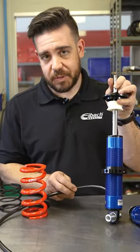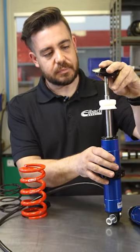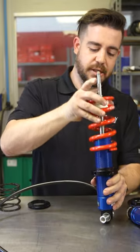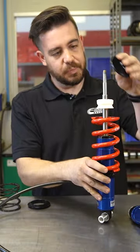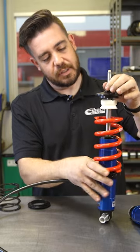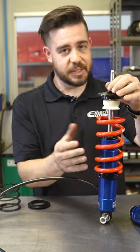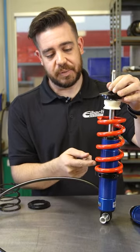As an example, we have this fixed body coilover right here. If you were to take this mainspring and drop it on, then put the top on, you basically have a whole bunch of slop in there and the spring can just bounce around and actually damage the body.